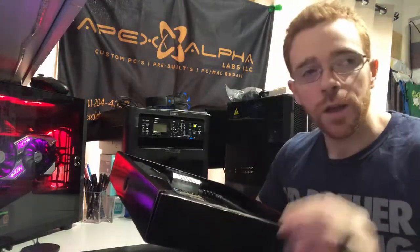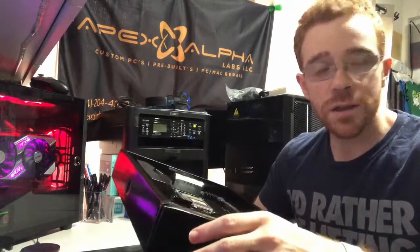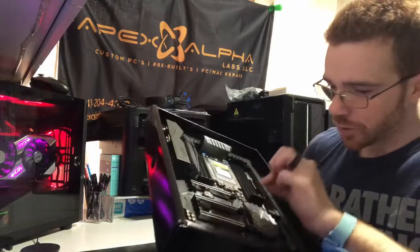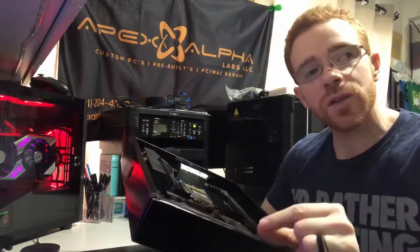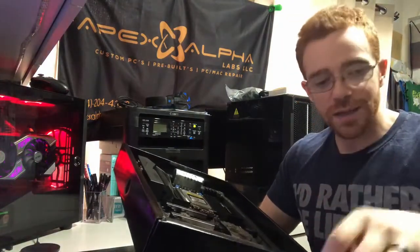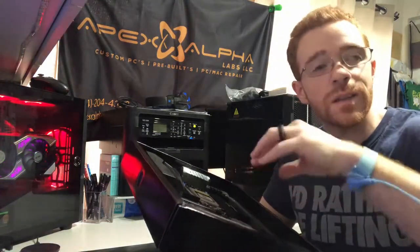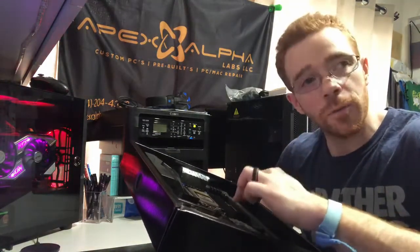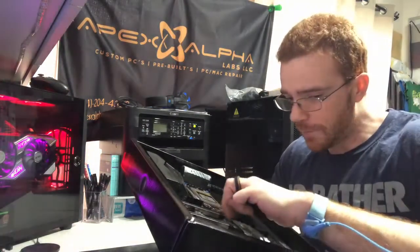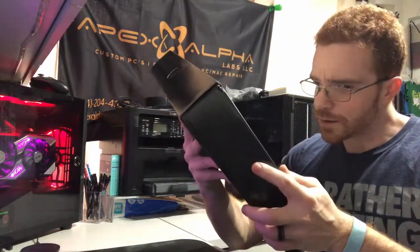So if you want to check your motherboard before putting it on a test bench or into your system, always look around the battery area. You will see either a sticker next to the chip or on the chip itself. The BIOS is usually an eight-leg chip — an eight-leg IC — so you'll see little soldering points going to the motherboard. It'll have a sticker on it or next to it, and sometimes it'll say BIOS, like this one right here — this is BIOS right there.